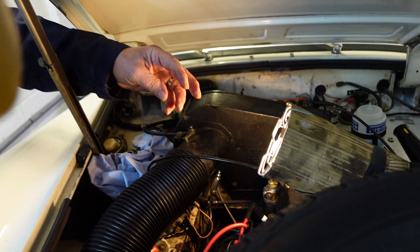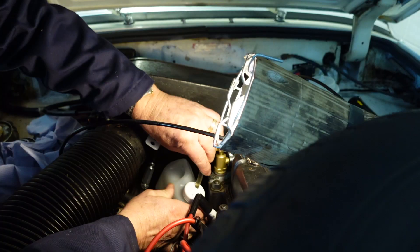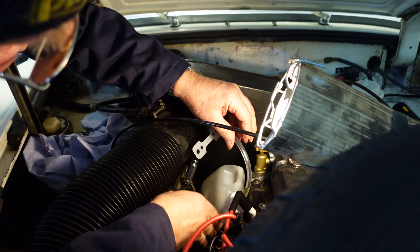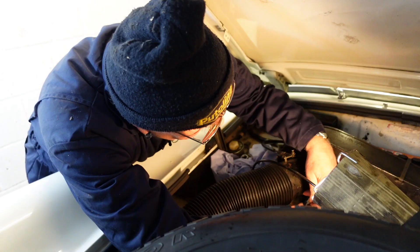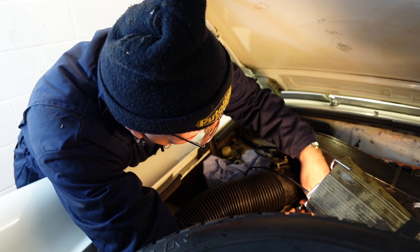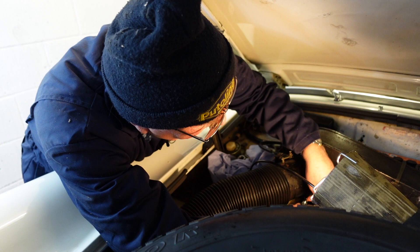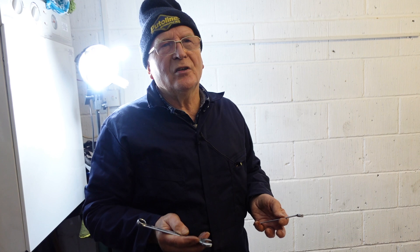This kit is the receptacle that the oil being pushed through the system will go into — it has a flexible hose on the end. You can see down the bottom there's the bleed nipple that I've brought up through from the clutch slave we've just installed. You've got to make sure the tube is at the bottom in the fluid, rather than just flapping around in the air. That's important so you don't get air back into the system when you take the pressure off. The master cylinder here is exposed, so we're going to undo the bleed valve — there's an open pipe between the master cylinder and the container catching the fluid.